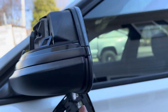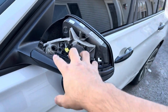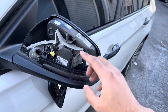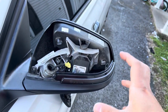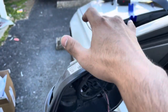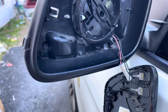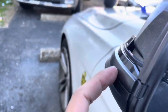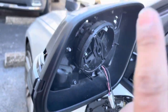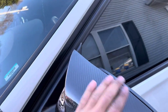Line it up and make sure it's all lined up in there, then get it to connect so you have the little seam all lined up. I always recommend that you test it out before you put everything back together, just in case there's a bad connector and you have to take it apart twice. What I recommend — and what I did on the passenger side — is put the screws in first, then snap it on. Make sure you put those screws back together so the turning signal doesn't come apart once you're screwing the rest in. I learned that the hard way.